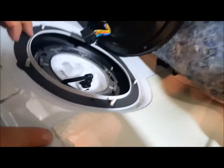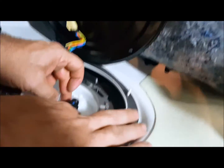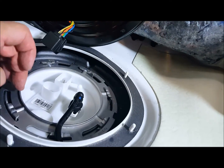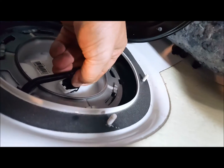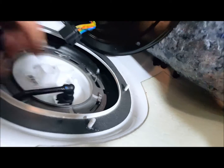On the stock fuel line there's a safety clip on the front side of it. You will take your fingers and just push the safety clip back, and then there's a little button up front that you depress, and then pull straight up. So that disconnects the fuel line.